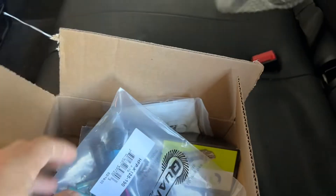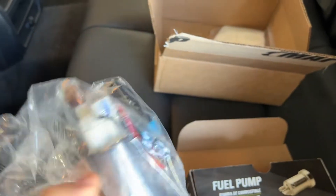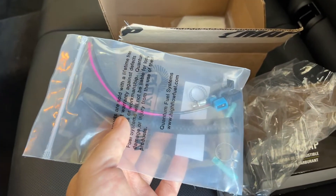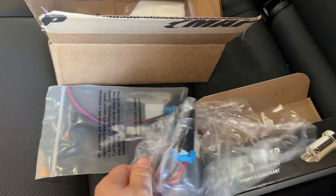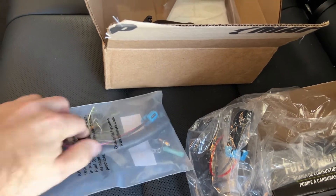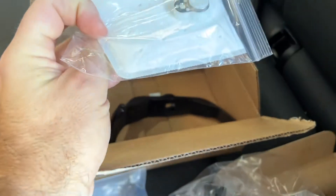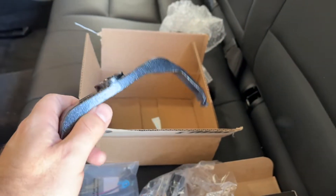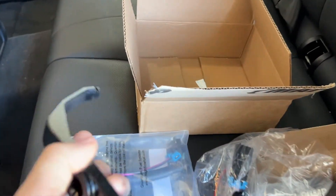Here we have the parts. The fuel pump — I went with an aftermarket pump, and this is literally just the pump itself. Not with a case, not with a regulator, just the pump itself. I got the idea from Grant, who did literally the same conversion. Supposedly a stage two pump — I'll put a link in the description. This is the assembly kit that comes with it: just a plug, some specific connectors, clamps, and a hose. Comes also with a filter, but I will leave the old one in. And this is the tool to remove the clamp ring on the fuel tank.